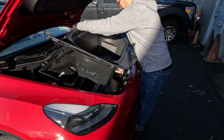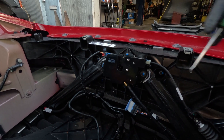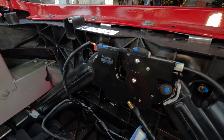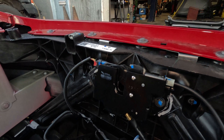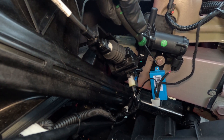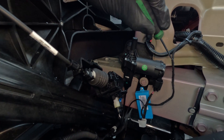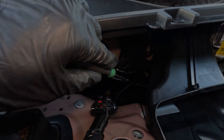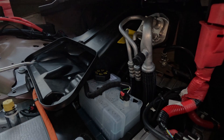With the liner out of the way, you'll be able to remove the HEPA filter by pulling straight up and out. The soft close device uses factory hardware and bolts on top of the OEM latch — these are 13 millimeter bolts. When the hood latch makes contact with this lever, it actually gets sucked down and pulled into the OEM latching mechanism. The motor itself is mounted to the frame rail using the existing factory hardware — I think this was also 13 millimeters. Because this system is simple, all it requires is power and ground. I simply followed an existing wire loom and ran these power cables behind the fresh air ducting, and everything's pretty neat and tidy.